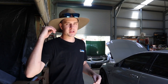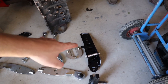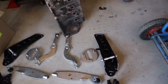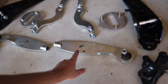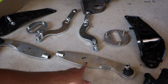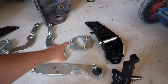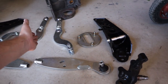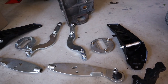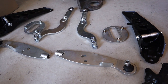As far as the R31 goes, we've got some new parts to show off — super exciting. From RB Factory we have his modified R31 caster brackets for S13 caster arms, his curved caster arms, his custom plated lower control arms which are R33 length plus 50mm — so these are super wide. We've also got his modified knuckles and camber tops to account for the extra width of the lower control arm, which allow us to correct the camber. Otherwise you'd have way too much camber and you'd never be able to get it out because the lower control arms are so wide.